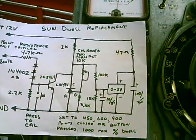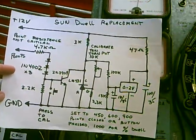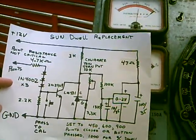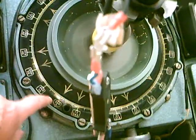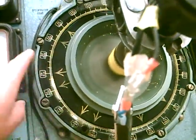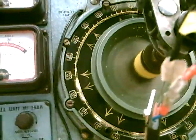Some people are a deer in the headlights when they see stuff like this, but I'm not trying to hide anything from you. If you have some kid to build this for you, that's a good deal. Thanks for watching. Again, look at that feature — you can read dwell directly off the scale. You set the pointer at zero, and zero is either here or there — it's always between the widest two sections. And depending upon which way the distributor is rotating, you can read it directly.